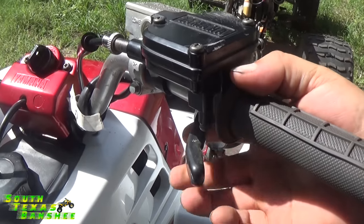I'm going to go to one and a half turns. They're starting to clear out now — you can hear the idle clearing. From this point, if you need to do any idle adjustment, keep your turns even. For instance, if the idle is too high, come out a quarter turn on one carb, then go to the other carb and come out a quarter turn. If you need to go in, go in a quarter turn at a time — or a half turn — then do the same on the other carb. That way your idle stays even, because we started out at two and a half turns from contacting the slide, so keeping them matched maintains an even idle.